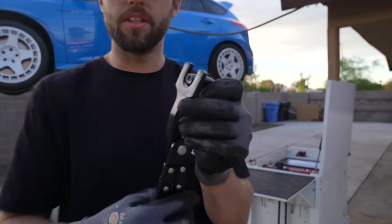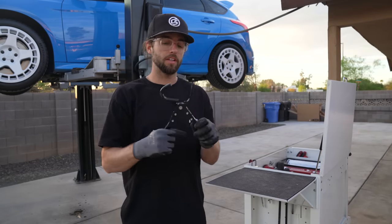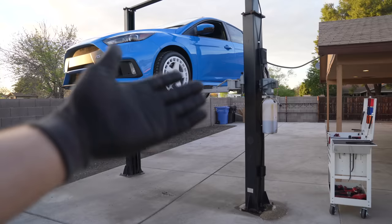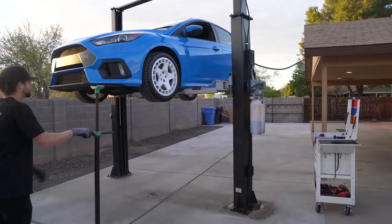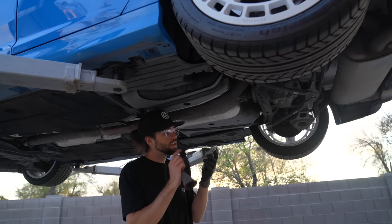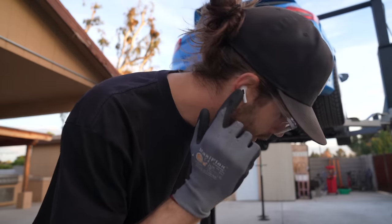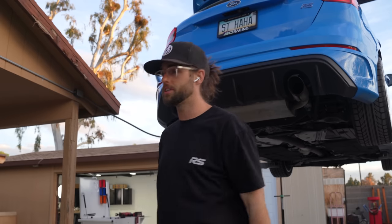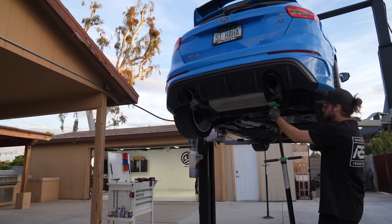This is a really good tool to have for days like this — an exhaust hanger remover. Link in the description and my Amazon storefront list. Go grab one; they're super cheap. I need to get my pole jacks since I don't have a buddy with me. Grabbing my Sawzall to cut the pipe. I've got the AWE directions out to figure out exactly where to make my cut — looks like right here. Before I cut, hearing protection is in. I've damaged my ears too much over the years under a car with an impact — just wear your protection. I'm going to support the rear muffler on both sides before cutting.